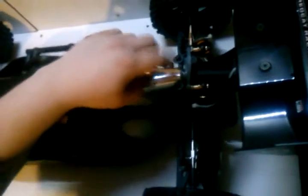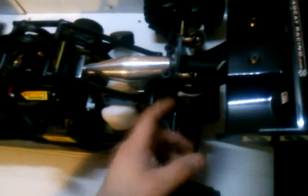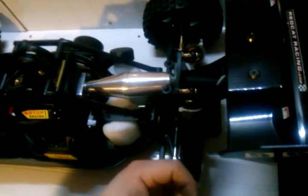So don't be afraid. One thing you do not want to do is really torque on the ends, because my buddy actually had the dual pipe set up, because he has the XT, I believe it is, if I'm correct. His pipes end right here on his truck, so he wanted to extend them out past the body. While we were in the process of doing that, we ran into a problem, and let's just put it this way: he had to order a whole new muffler. So the best thing to do is just do a rubber hose.